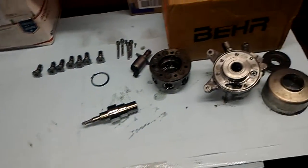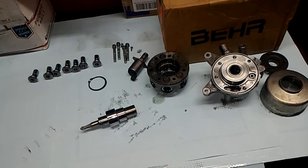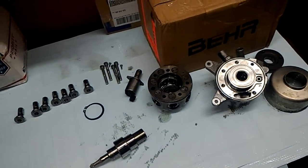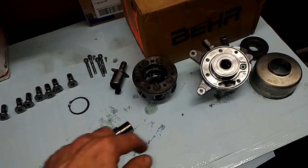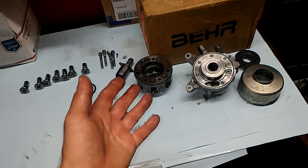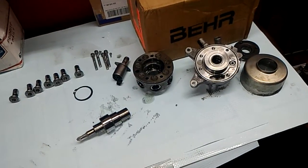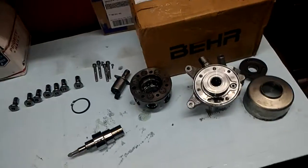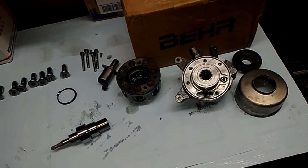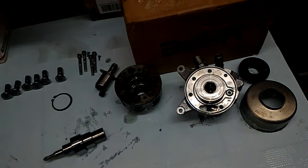Another interesting fact is that I didn't know if the pump was dead or not. Before I removed it, I changed the high-pressure hose, which is under the engine — it requires lifting the engine up a little bit to get to the hose. It was ruptured completely. Once I put the hose on and filled the reservoir, the rear suspension actually went up, but the front only went up a little bit and stopped. Checking on the Star diagnostic, it said there was zero pressure in the system — like the pump isn't pumping. Literally zero, so I knew the pump was bad. The car is still in pieces — no radiator fan, no coolant hoses — so I could remove the pump fairly simply.